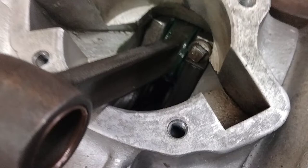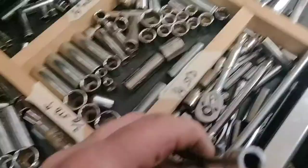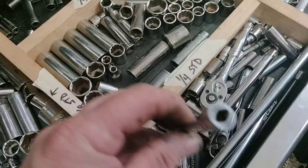Then you put your bolt through here — it's a square drive, 6 millimeter, which is also very close to a quarter inch. These are actually hard to find a socket for. It took me quite a while — at one point I was just going to buy two cheap quarter inch extensions, cut off the ends and weld them together so I had a quarter inch drive on each end to torque these down. But I managed to find a 6 millimeter square drive that would work.